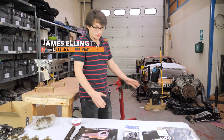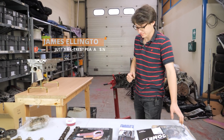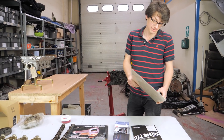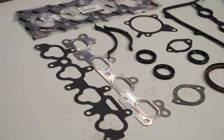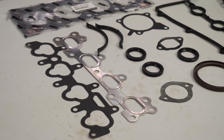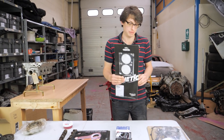In order to do that we've got a pile of parts. Some of these have been stored for the last two months in clingfilm and need to be cleaned. That's the secret to engine building - you just clean everything over and over again. We've got a gasket set because he's putting big boost through it, and the 1.6 head gaskets are not multi-layer steel, they're composite. We've got a Cometic head gasket, standard size because he's using his old standard pistons.